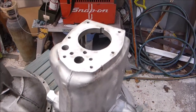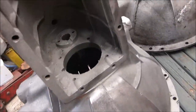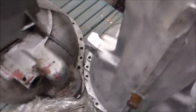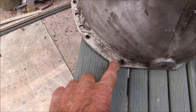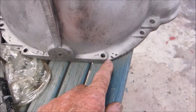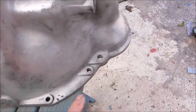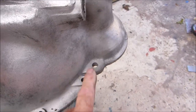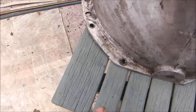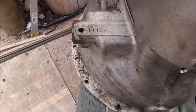This is the first part of stripping out a gearbox. This is one I've already done — it's been shot blasted, cleaned inside and out, and it's ready to go. This one is out of the TR4, the original one with the thin flange, and this one is TR6 and TR4A, which has the thicker flange. You need slightly longer bolts for the starter motor and the other bolts — don't use the ones from the TR4 because they won't have enough thread on them.